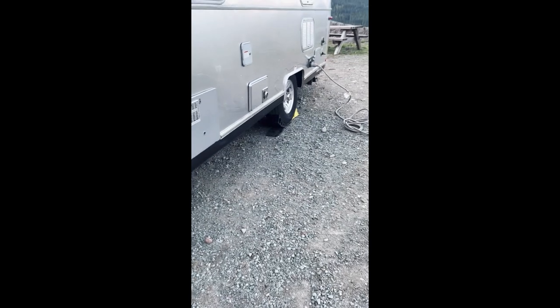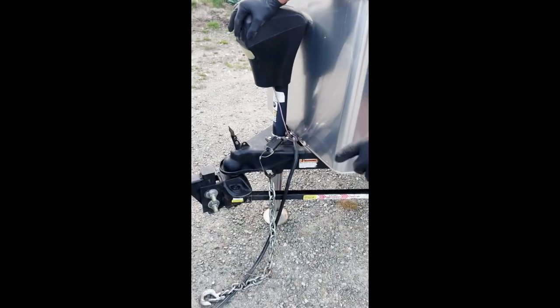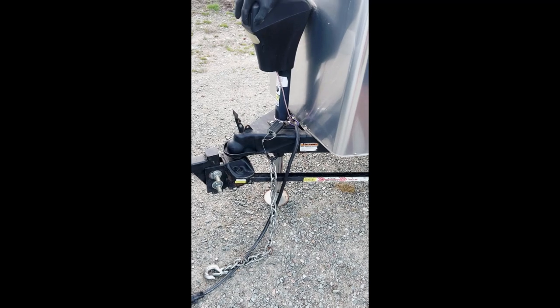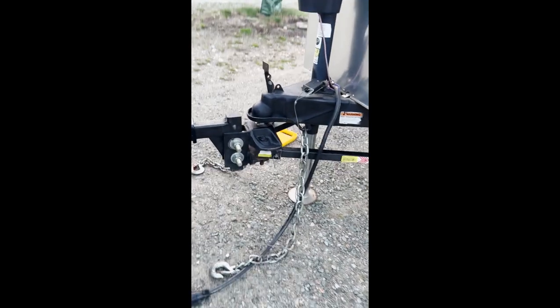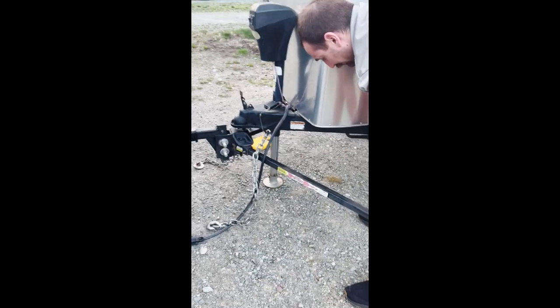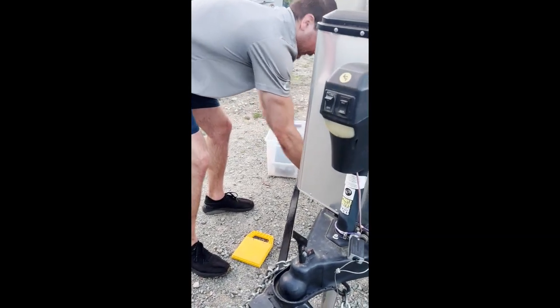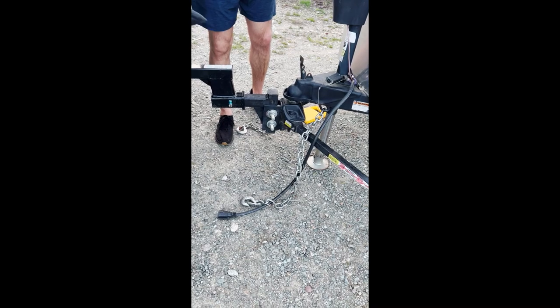Really important right now to make sure that you have your wheel chocks in. The yellow wheel chocks should be underneath the tires. If you don't have those in, as you start to lift this up, if you're on any sort of slant, then the trailer is free to roll back. As you can see now, the pressure has been released off the stabilizer bars, so those are really easily able to be taken off. Just make sure you replace the pins so that you don't lose those. Now we just need to lift the trailer up so that it can clear the ball, and then we'll be able to move the vehicle.